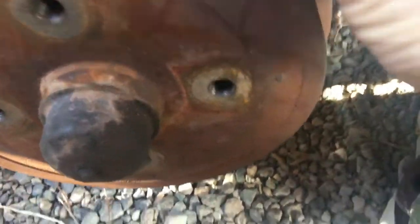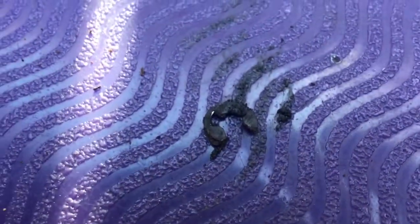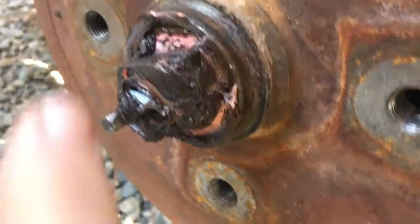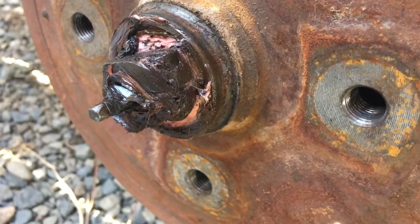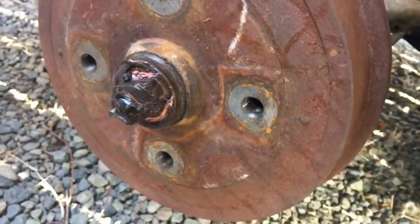The first thing we're going to do is get off our hub, and there should be a little gap here somewhere where we can do that. There's this tiny little circlip — a little e-clip on the end of the shaft that you have to pull off. Then we get our cap off, and inside there's the speedometer cable, and you've got this little nut that's got a lock in it. It's got a little allen head screw in there, but you can see the grease on this is really old and bad — it looks like it got some water in it. So we'll be taking this all apart and redoing it.